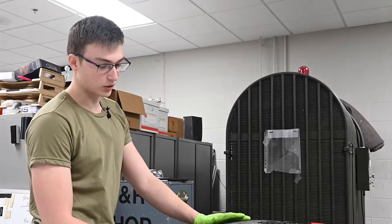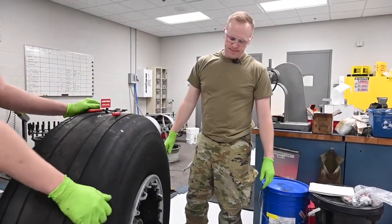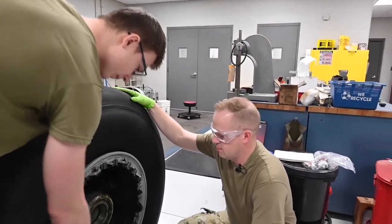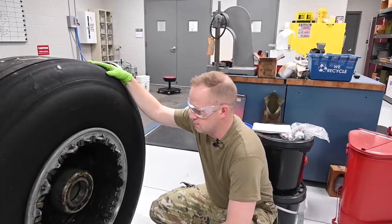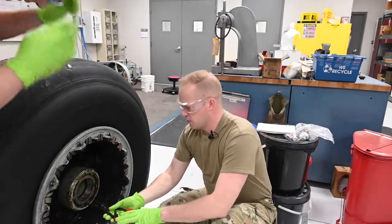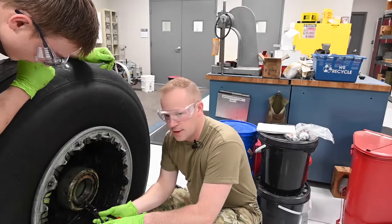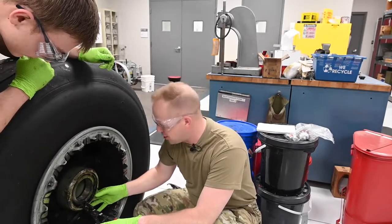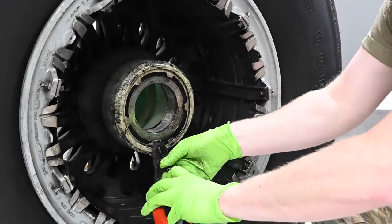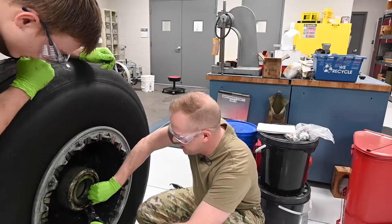For the first step, we're going to remove the snap ring and take the bearing and inner rubber part out. We'll use these internal pliers — pinch that together and pull it out. Now you may not be able to see but this is actually really pretty greasy. Every time we're working with something with tension we need to have our safety glasses on.